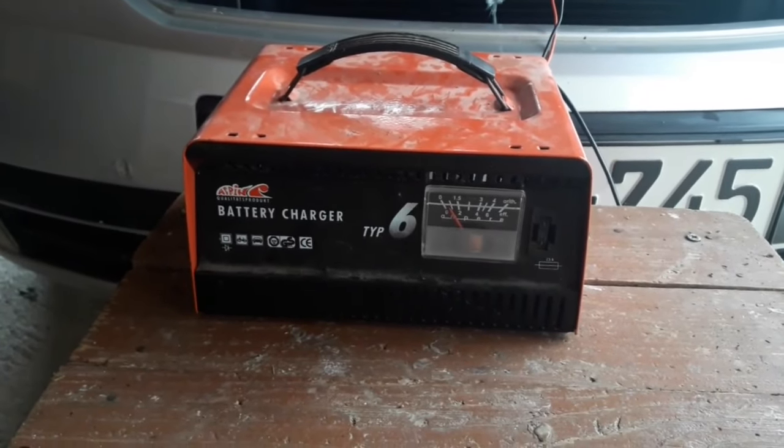Make sure, when you've finished, that the engine bay is free of any obstacles or leftover tools. So, can you charge a battery while it's connected to the car? Yes you can, but you have to be a bit careful. Watch where you put the charger, how you connect it, and where you've put the power supply. Don't hurry when doing this — even if you're in a tight spot regarding time, take it easy and think what you're doing, otherwise you may cause even more problems. With some luck, you may get your car running again in about half an hour or an hour. If the car battery has let you down numerous times recently, best buy a new one as soon as possible. It would also be good, if you have the means, to check the alternator voltage once you've started the car, just to be sure that the battery was the problem.